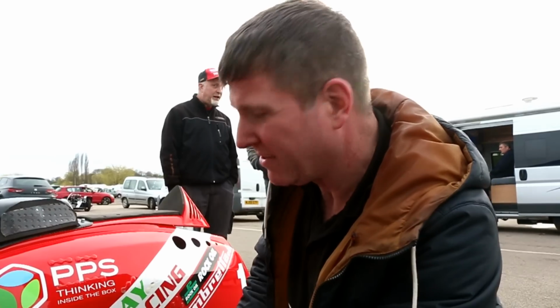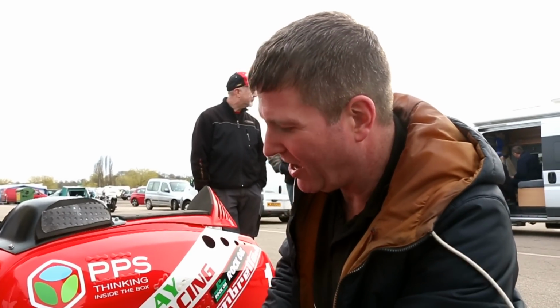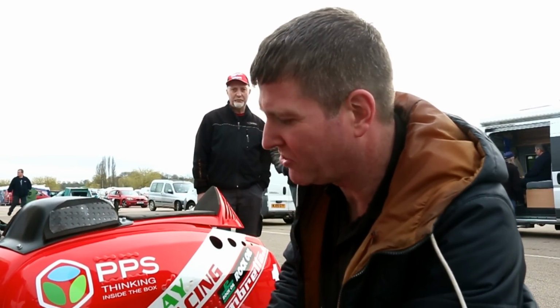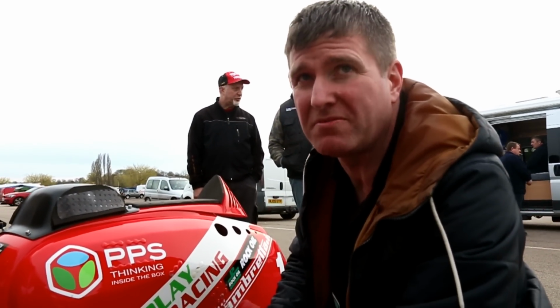But what's the engine in it? It's a small block motor, so it's quite a unique Chalky motor. But it's got a Super Immola cylinder in there. Big stroke, big crank on it, so long stroke. And yeah, it's just trying to get the revs in there, trying to keep the revs, but also get a nice punch. Are you still running 4-speed? 4-speed gearbox on it, yeah. So it's just a close ratio gearbox, no 5-speed.